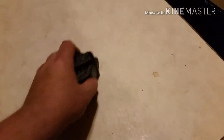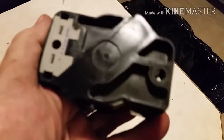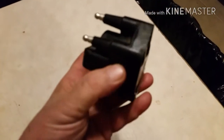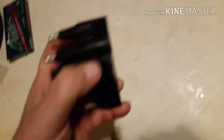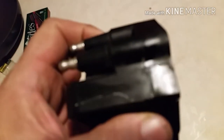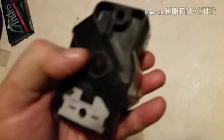They were going to take it into the store to test it, but when they got it off they had a quick look at it. If you look close right there — the whole coil is split right there and the crack continues up the side where my thumb is. It's very, very small, but it's there. Once the coil cracks like that, it loses spark energy — a lot of times the spark bleeds out through the crack.